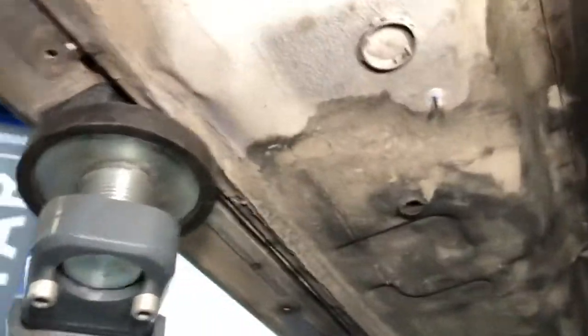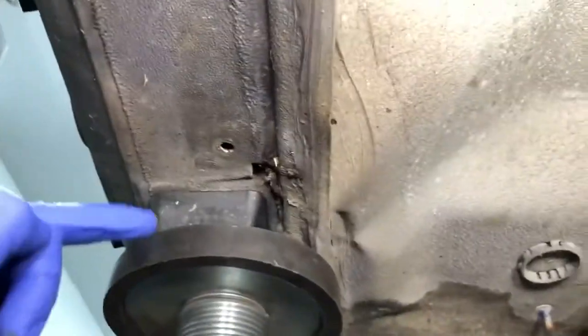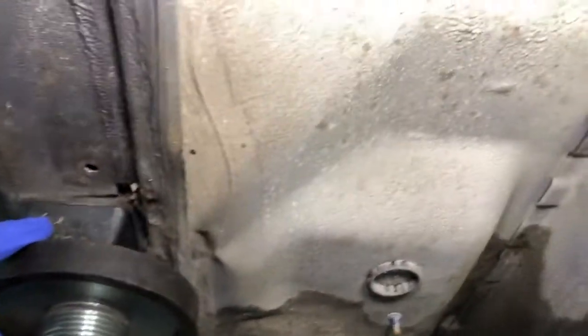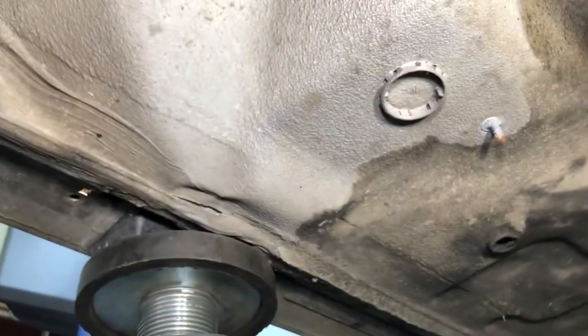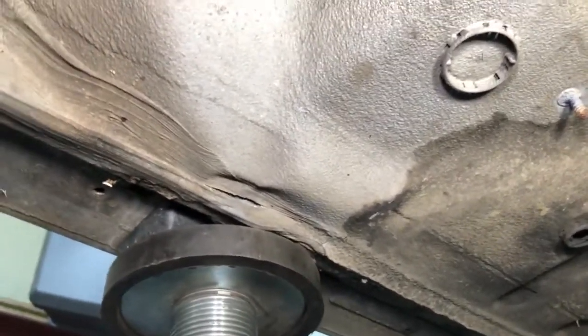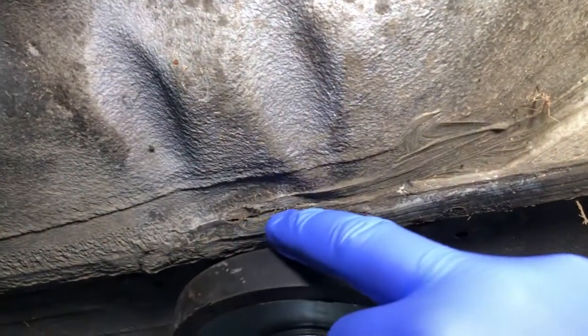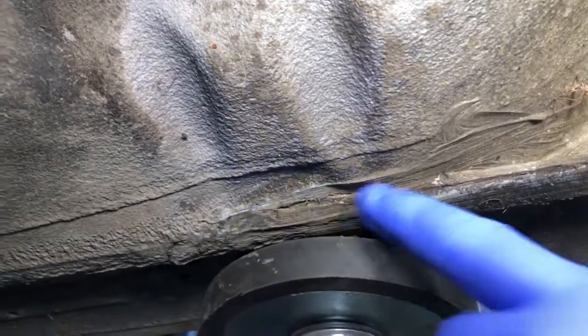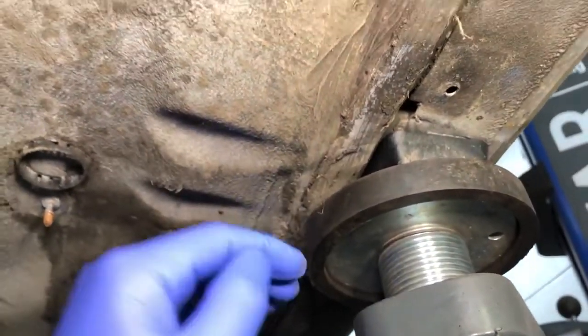We can see it's been jacked up poorly before in the past because there's a seam sealer split just here. Somebody's obviously jacked it up inboard of the jacking pad, which are the pads that stay present in all of the car's chassis, and it looks like somebody's distorted the floor. Quite a common thing that we see sometimes for rush tyre installs. Not saying any tyre fitter has done it, it's just sometimes we see that sort of thing. So there's an issue there we're going to have to address and investigate to see if there's anything different. Probably should be similar to this side, where there's this side looking a little bit gapped as well. That might just be mud, or it might be deformation where a big pad, sometimes like huge trolley jack pads or long trolley jacks, might have touched that and caused a sort of a seam sealer split. So we need to look into that area.